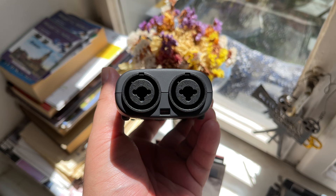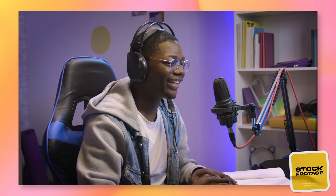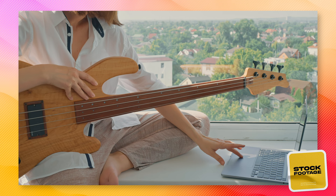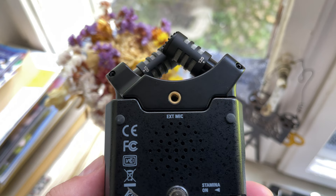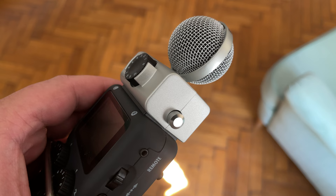To start off with, let's see how many inputs each recorder has. The Zoom H5 has two XLR-TRS inputs, plus a 3.5mm input in the default XY capsule. XLR-TRS means it can accept not just an XLR cable — which is what you'd use with a microphone — but also an instrument cable, like a guitar or bass cable. The 3.5mm input is basically intended if you want to connect a lav or radio mic. Bear in mind that, unlike the H4N Pro which has the input built into the body, the H5's input is part of its detachable capsule. If you place a different capsule on it, it may or may not have a 3.5mm input.